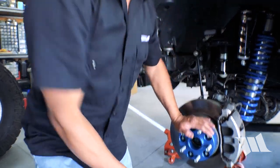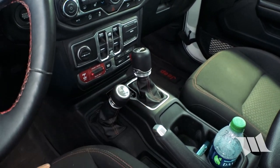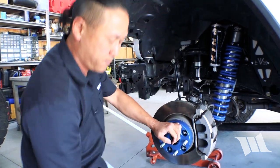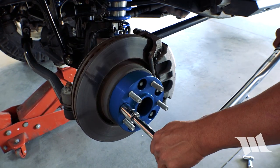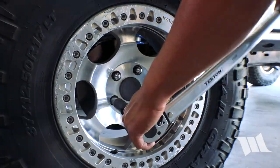Or if you're by yourself, you can take your transfer case and shift it into four-wheel drive. As you can see, with your transfer case engaged the front axle isn't going to move. So again we're going to use our 22mm socket. And there you have it.